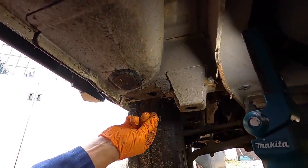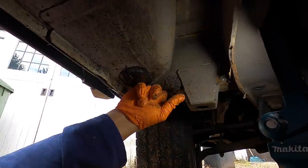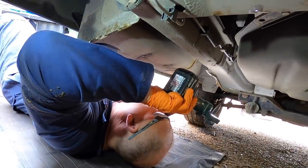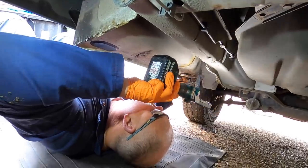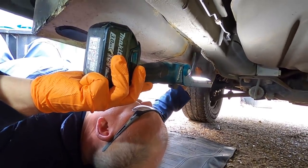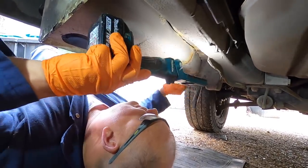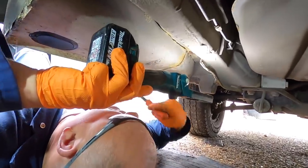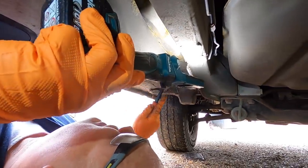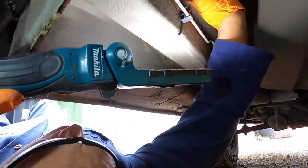Of course that gets wet, lays in there and rots — but in there it's absolutely solid, it hasn't been in there long. So moving up here, this is all really solid through here. There's a rust spot there — if I tap it, it flakes off and then it's solid underneath. It's literally just surface rust, just the underseal flaking off. We can treat all that, and I'll get my hand up to the top of this box section.